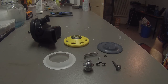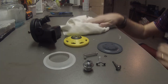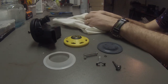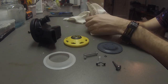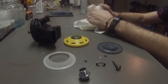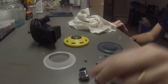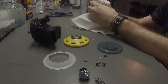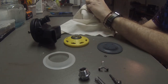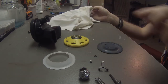Everything is clean and now we need to put it back together. What we're gonna do is apply some silicone spray to everything. Get some silicone spray on each part and wipe it off so you don't have excess. Same with the spring, the pressure seat, the lever, the little bolt, and also the little spacer. Those are the parts that need silicone.